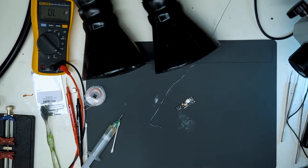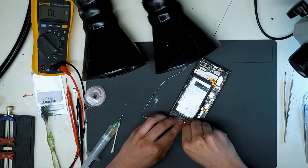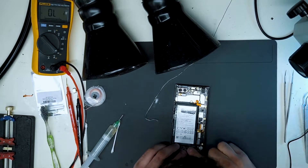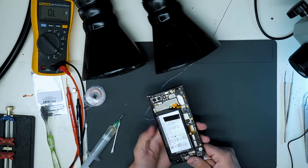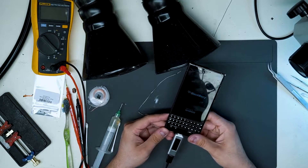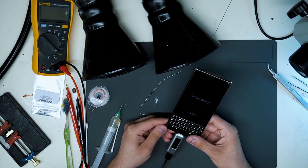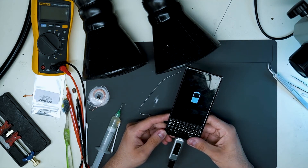Now we are ready to proceed with testing the phone. We're moving the scope out of the way and grabbing the device. We're going to place the daughter board into the housing and connect the flex cable to the FPC connector. We notice a tad of corrosion from the original damage — we cleaned it off. Connecting the battery and plugging in our charger with our USB-C meter, we see that the device is drawing almost 2 amps, which is normal and it is charging. This phone is fixed and ready for reassembly — we can get it back to the customer fully repaired. Thanks for watching.